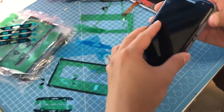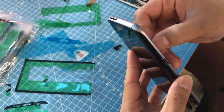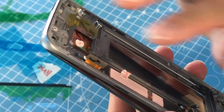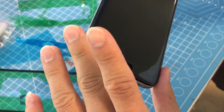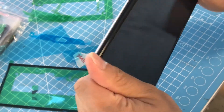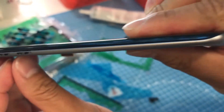Put the flex in first, and then lay it down on top. Make sure it's aligned with the earpiece cores. You're pulling the flex out because you want to make sure that the flex is not getting stuck. Once everything is aligned and looks good, lay down the bottom bit along with the button. You can see that there is currently a gap along the frame — it's not fully pressed down yet.